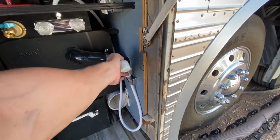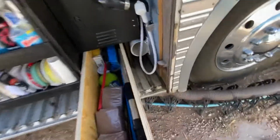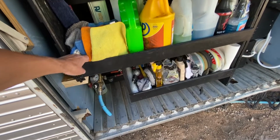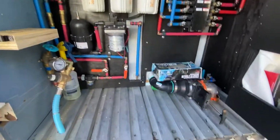And then here I'm just going through the drawer, so it was a 4-foot drawer. I didn't seal the inside of it. It's treated wood, but just to make it aesthetically pleasing on the outside, I went ahead and painted it black. And then here's the real thing I wanted to point out too, is that cleat that I put in there for locking the drawer. I actually raised it up about a 1/2 inch to take some of the pressure off of that cabinet whenever we're driving.